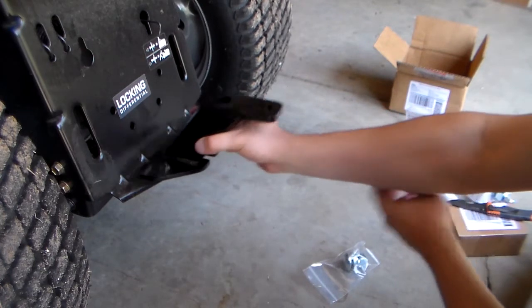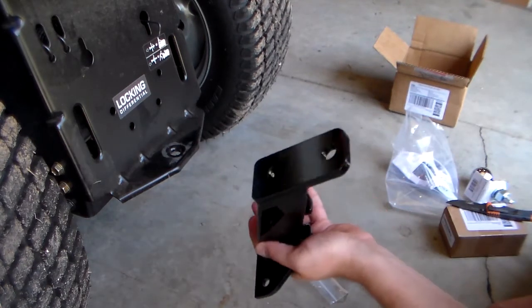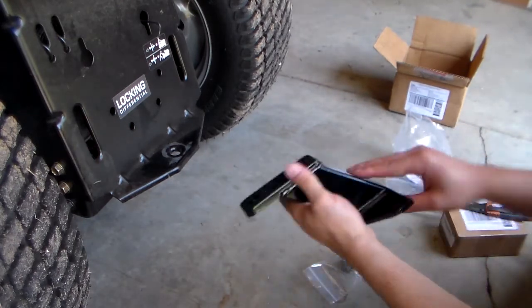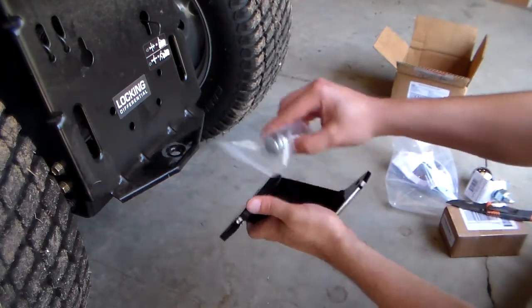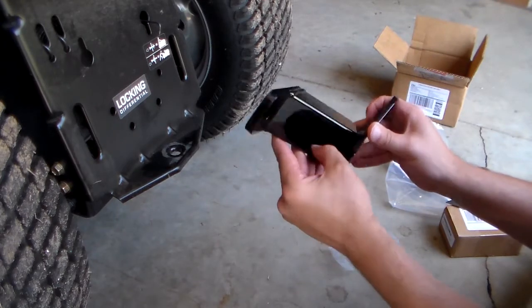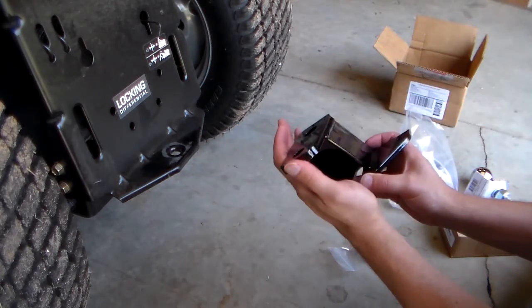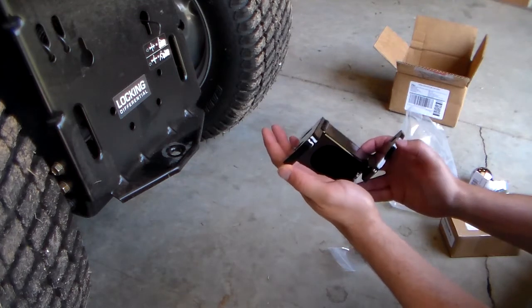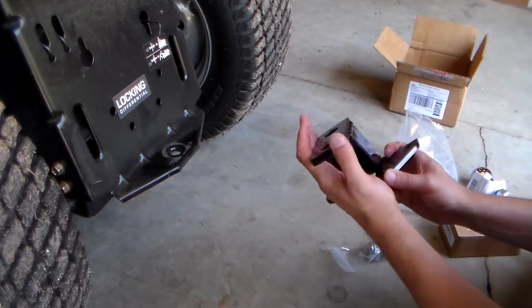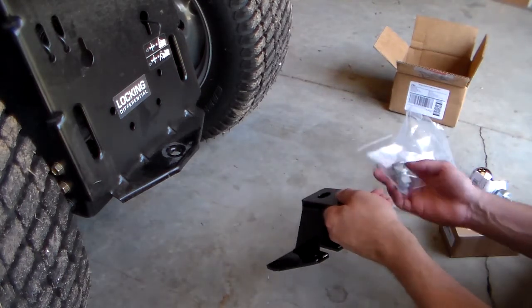Some hitches I looked at bring the ball quite a ways up, but there were a lot of reviews and complaints about them being too high, so I figured this was the next best thing. I got this particular one on Amazon. It's pretty solid with good welds — I'd say it's at least an eighth-inch steel all the way around, with the exception of the base plate and top plate, which are at least a quarter inch on the bottom and probably three-eighths on the top. It also comes with instructions and mounting screws.